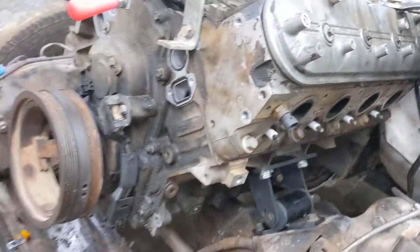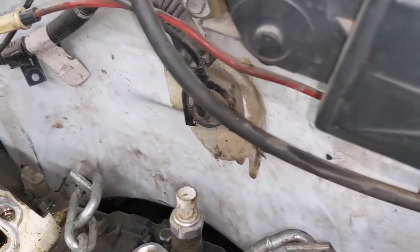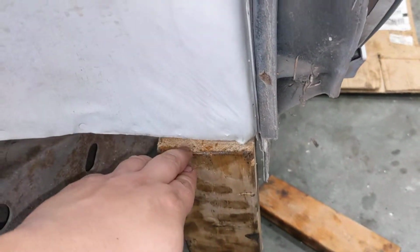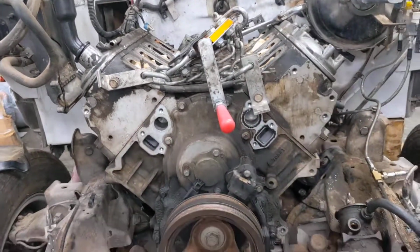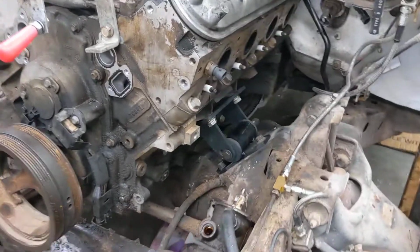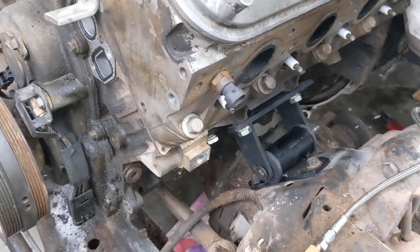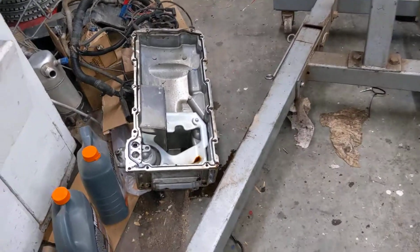So that leaves me two options. I can either put the engine in and then bolt the transmission up to it, which, judging by the fitment, I might be able to get to. Might. But it does clear. Now, I've lowered the body already. This is actually just there, it's not holding it up anymore. So there is room after you bring it down. And I tried lifting up the engine and squeezing. Ultimately, I think what's going to happen is I'm going to have to drop the differential, shoehorn the engine and transmission in on its final voyage, and then bolt the diff in the front. Honestly, the only way I see it right now. Pardon my messy shop. As you can see, there's the pan.